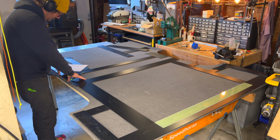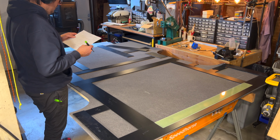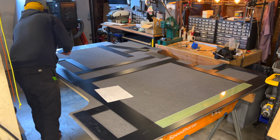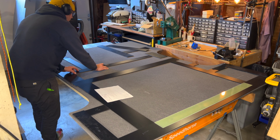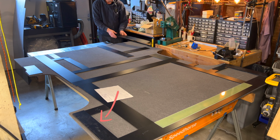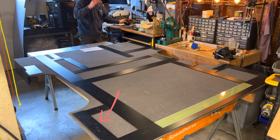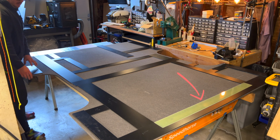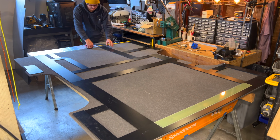You can see me referencing back to my cheat sheet that I laid out in CAD with the appropriate dimensions. I made no strip less than 3 inches wide so that no matter where I put it on the floor, it was sure to land on top of a rib since the space between them is less than half this value. For areas that didn't have any ribs, I cut 2 pieces of 1/4 inch to laminate them into 1/2 inch so it would keep the height the same. Also for areas under the L-track and seat, I used FR4 instead, which handles high force compressive loads way better.